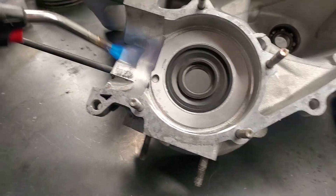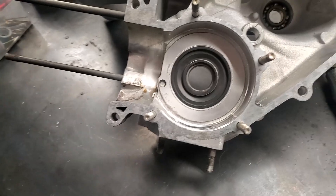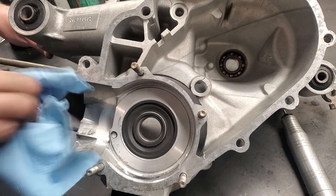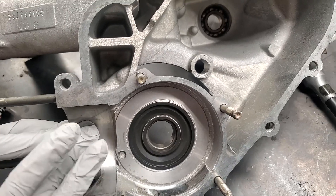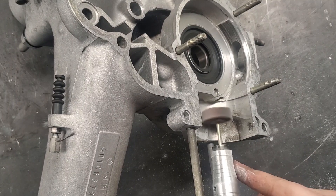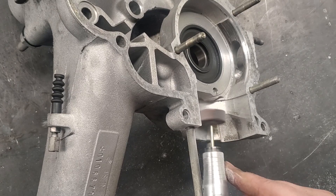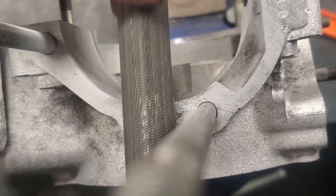The existing ports in any P200 case kind of feel out of place — they don't do anything — so I prefer to close them up. I use a two-component epoxy, a high-heat version of it. I clean the cases thoroughly by heating them up and then cleaning them with brake cleaner, and then I push a big dab of epoxy putty in there. Then with the rotary tool I clean up the excess epoxy, following the arch of the crankcase. As long as you create clearance for the cylinder, this doesn't have to be super accurate. For the gasket surface I very gently use a file — I've got to be really careful not to damage the gasket surface here.